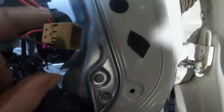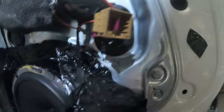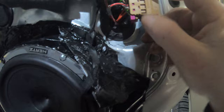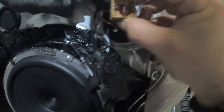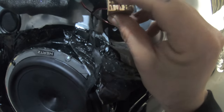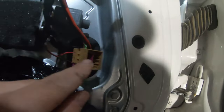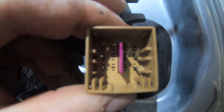On the passenger side, this needs to go into the box. Position the box so that the purple plate at the back end is on the lower side, facing you — top left is number 12, and then it works backwards: 11, 10, 9, 8, 7, 6, 5, 4, 3, 2, and so on. The red-black needs to slide into number 12. So that's now in — top left is 12 and then 11.